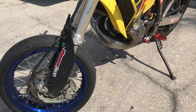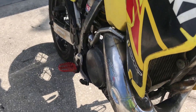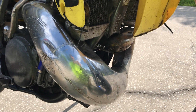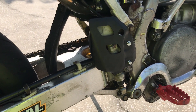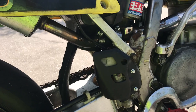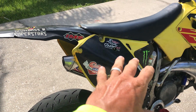The hardest part of the swap was getting the pipe to work with the radiator. I kind of had to beat the hell out of the pipe — I'm still gonna fix it up. I had to really dent the pipe to get it to fit. I didn't take into consideration that the radiators would be so far down. The sprocket's way off too, so to get the chain to line up you have to really scoot the motor over and grind everything to make it fit.